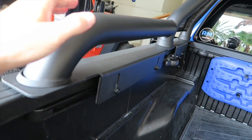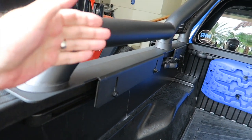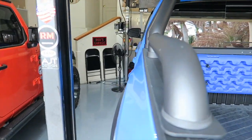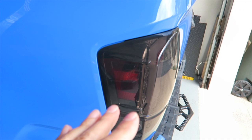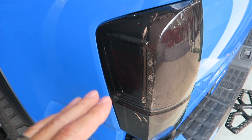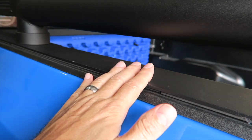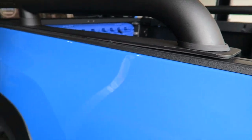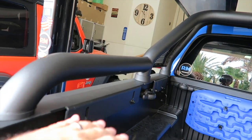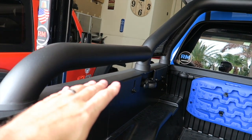So I'm going to have to deal with that. The problem is I don't think I have enough slack in it that, when I pull this forward and tip it up a bit, it won't break the wire. So I'm going to cut the wire rather than remove it from the brake light back here, which I don't want to do because it's a nice, good connection and I don't want to mess with that. So I'm actually going to cut the wire — there will be two wires in there — and then I'll end up splicing them back together, which is okay, because then I can lengthen or shorten it however I want once I have it sitting back in place. That'll work out well.